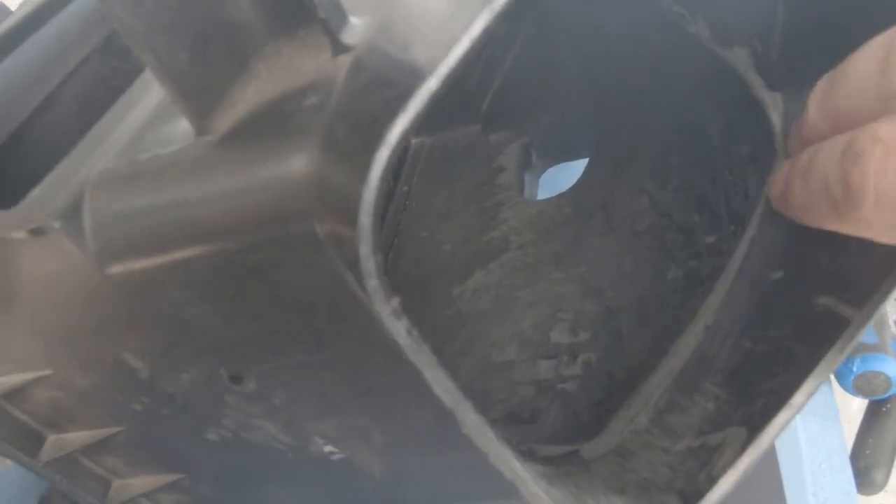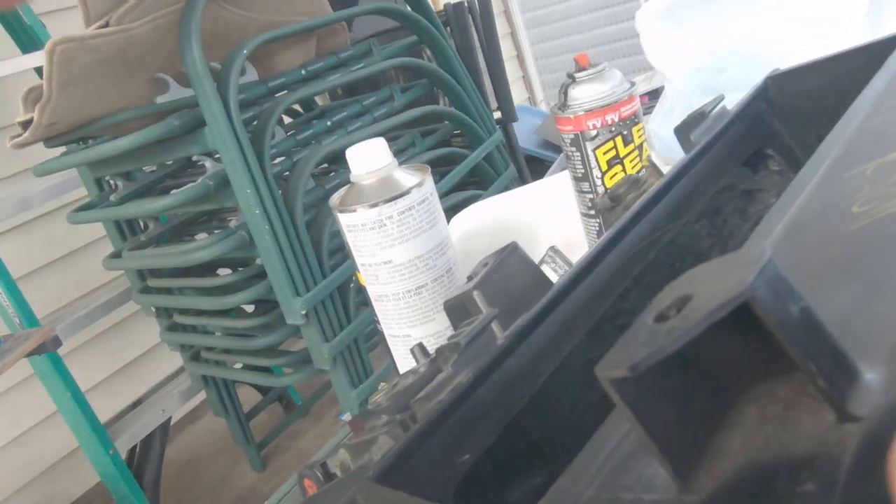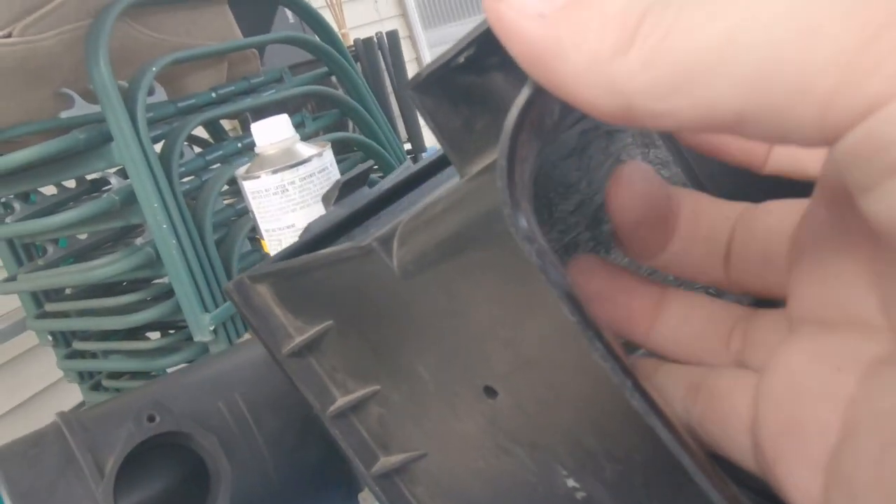I actually got a really good edge on this. I don't think we're going to go too much farther and we didn't bust through the edge, so no epoxy required. That's a really nice taper. There is a little bit of a lip on this edge that I can probably smooth out a bit, but way, way better - way smoother, no lip. I was even noticing on this part, because this is actually two pieces of plastic, you can see where it's kind of fused. Just take your fingernail and run it along, and anything your fingernail can get caught on going both ways, we're going to sand it down and make it smooth. There's a bunch on this edge too.